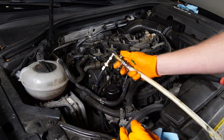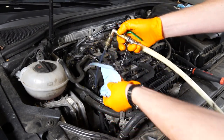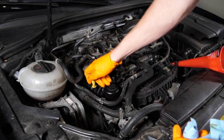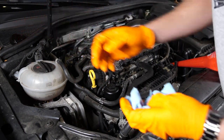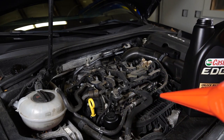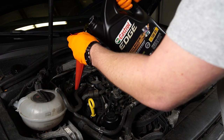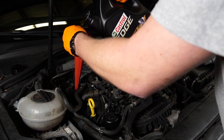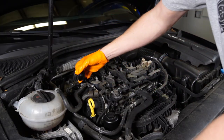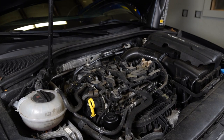You can hear it's barely sucking up anything now — I can't get it past so we're going to leave it there. Pull this back, put your dipstick back in. Let's put some oil in this thing — clean that up, you don't want anything getting in there. Most of you guys are probably pros at pouring oil but I've got a nice funnel here. They say it takes 4.8 to 5.2 quarts, so I'm going to pour the whole five and go from there — I can always suck some out. Go ahead and put the cap back on.